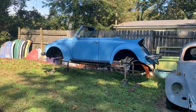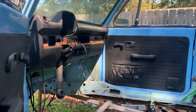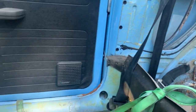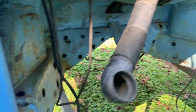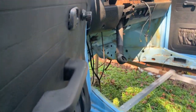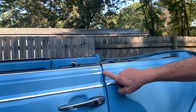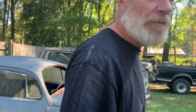This is an early version. We've got a later version out here if you guys want to go look at it. So here's the other one. This is a '79. You'll notice that it has the same type of supports as the early version, but there's a little less metal up in the corner now. Still has the braces, although they're not quite as hefty. Still has the inner braces that go over the heater channel. And there is actually another set of supports — they look a little bit different, they go off into here. It keeps a car from doing this. So if you ever see one with rotten channels and this gap doesn't line up, you can actually see it dropped a little bit — it means it spread just a little bit, which is normal over the life of a car with metal fatigue.